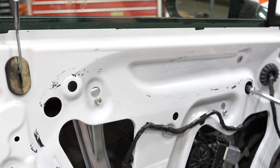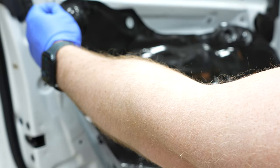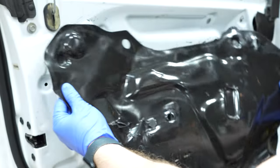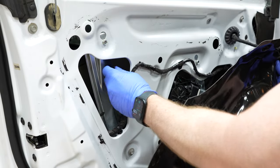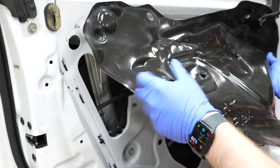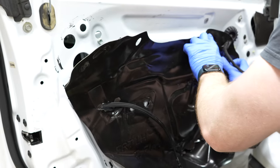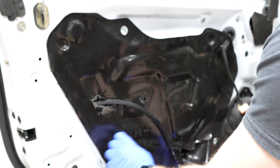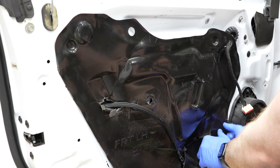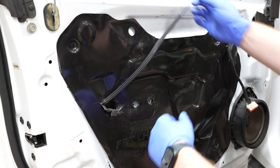Just feel it out — wrist tight, just like that. Then we can put our rubber mat back on because we're on the downhill from here. Look at how it lines up, feed our wire through here, and the door latch cable goes through this right here. Line it up how it was when we found it. If you're feeling snazzy you can put a new bead of silicone rubber around there, but in my experience this stuff is almost reusable.